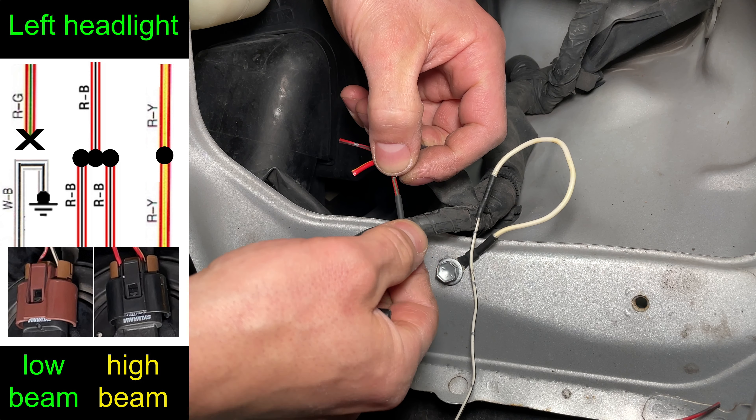Let's take a closer look at the headlight. It has a level indicator on top, up and down adjustment on the back, and side to side adjustment too. This headlight has one light bulb. The left side is the same. Let's get that trim piece out. Remove all four headlight mounting bolts, then pull the headlight out and unplug the 3-terminal connector.